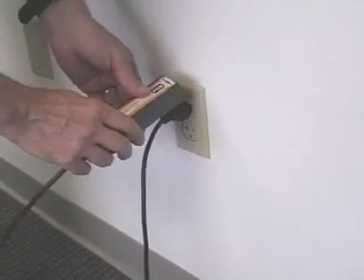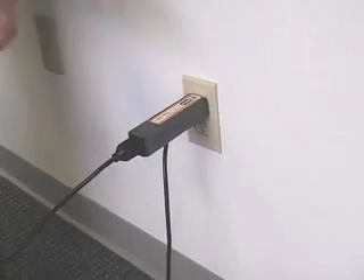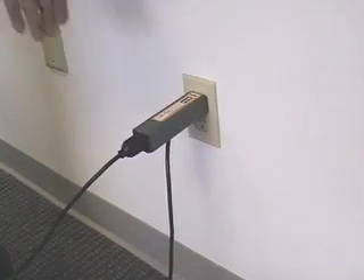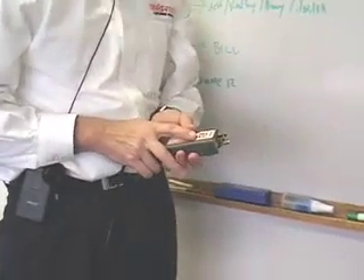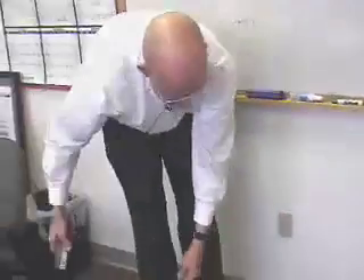We then take the plug capture device — it fits on easily and goes right over the existing outlet. I'm going to go over to Hot Plug and arm it. There, we've got a green light. Now I come back to the plug capture device and pull it out of the wall. At this point we have hot electrical contacts, and we're ready to plug it immediately into the UPS. I've plugged it into the UPS, I have a good contact. I can remove the plug capture device, and we've completed our objective. We're ready to remove the computer from the room.